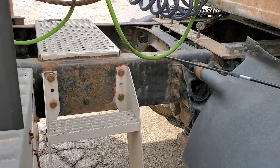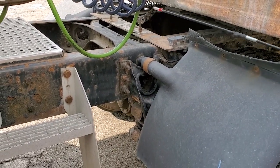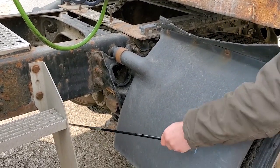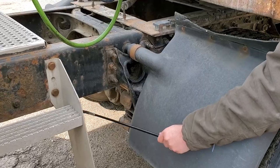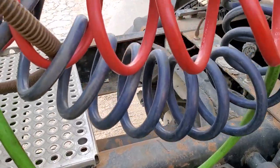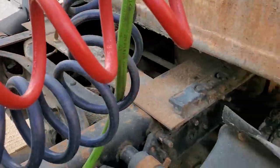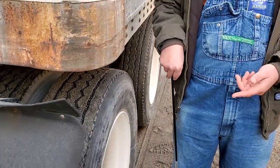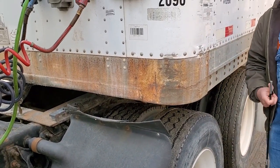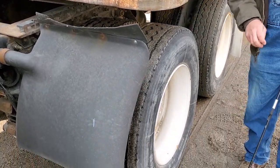The frame — go from the top flange all the way down to the bottom flange, front to back on both sides. Not cracked, bent, or broken, no illegal welds. The drive shaft and U-joints are buried in the middle of the truck — the drive shaft is the big round tube, and U-joints are at the ends. Drive shaft and U-joints are securely mounted, not cracked, bent, or broken, and U-joints must be well greased. The exhaust is securely mounted, not cracked, bent, or broken. Clamps are tight and not leaking — leaks would be indicated by black soot.